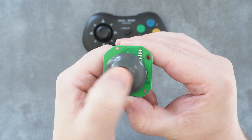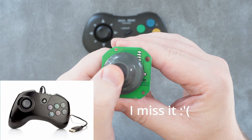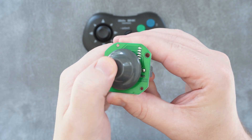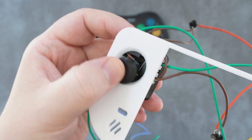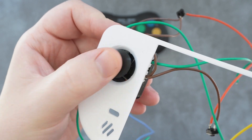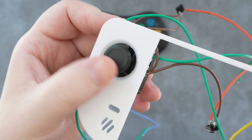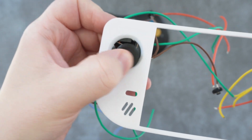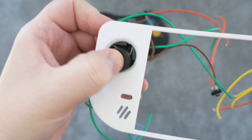Unfortunately, these old fightpads all used rubber coatings which, after aging, became sticky and oily and gross — hence I ripped the stick out to prevent wasting it. Finally, here is my own clicky stick, which I'm putting on my long-overdue DIY handheld, the RB2H. I'm just using a simple array of lever arm switches — it's obviously a more DIY approach, but in my opinion the clickiness is still more tactile and better feeling than this new Neo Geo Pad.